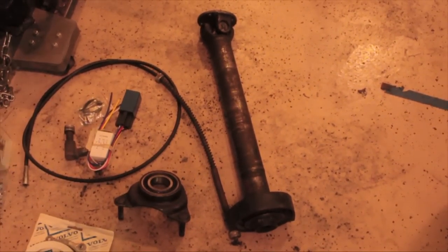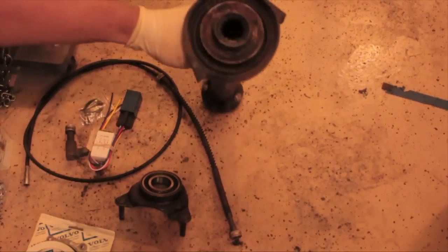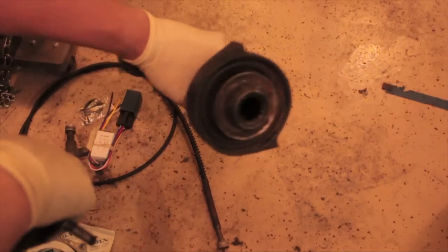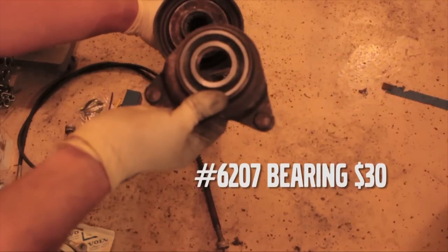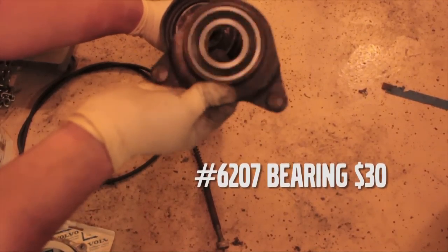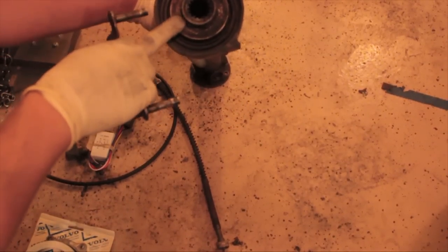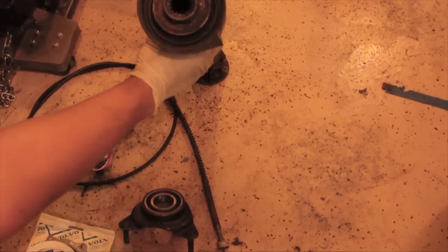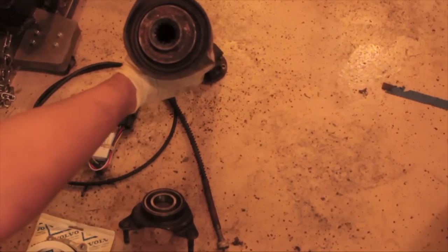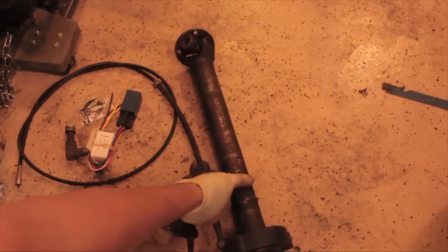Moving on — what's going on with this drive shaft? It's shorter because you can't have a half shaft that's longer. My center carrier bushing doesn't look like that — I've got an earlier style drive shaft. But I've got your solution here: using a fancy bearing part number you can get on Amazon, it fits perfectly in here and allows the larger opening for the newer style drive shaft to fit. You basically replace the big nut and washer and slip this on there and it works. Crisis averted, because we don't all have 1967 and up model year cars — mine's a '67 on the title but it's a '66 every time I buy parts for it.